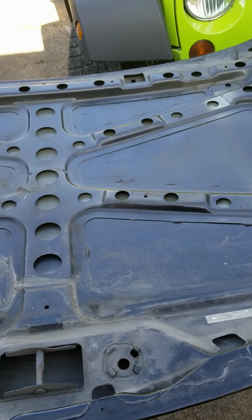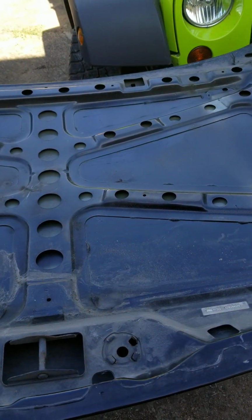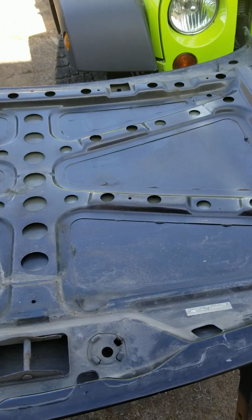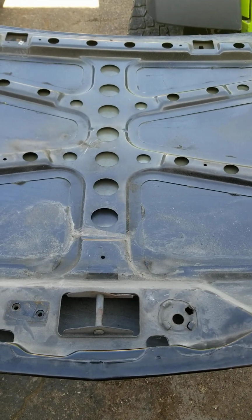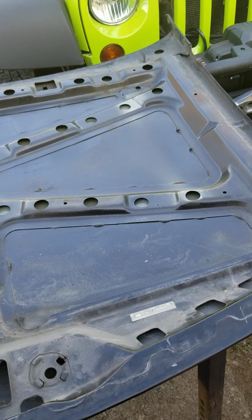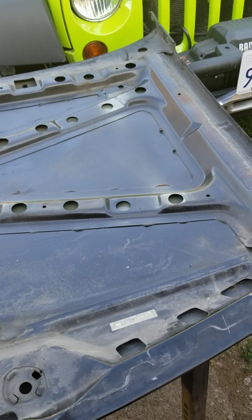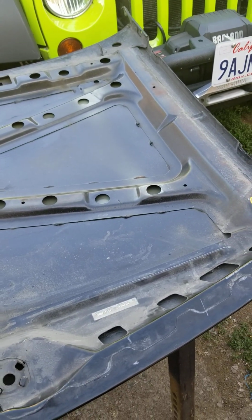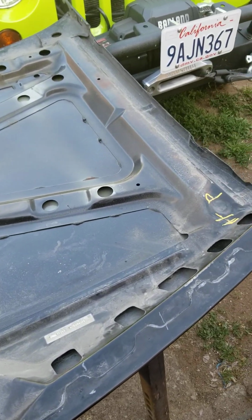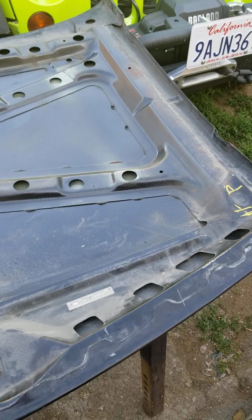For the dark pastels like blue, red, maybe orange, things like that, you want to use red oxide primer. But when you're shooting the lighter colors, light blue, light green, white, silver, you want to use the gray primer, and you can lay that down on here, and it will really seal this color in.